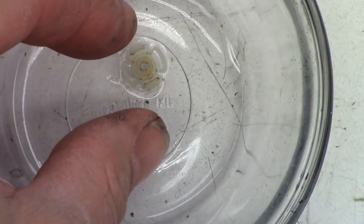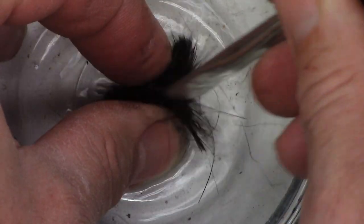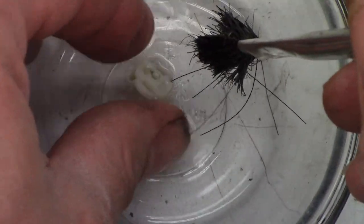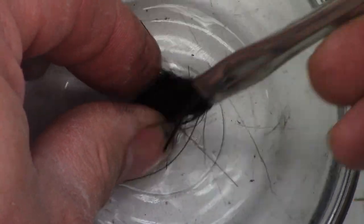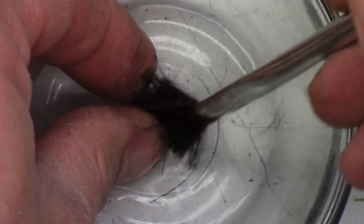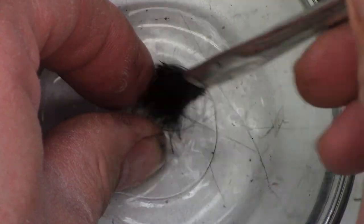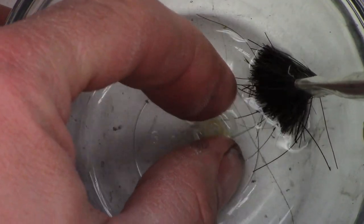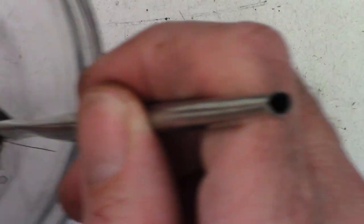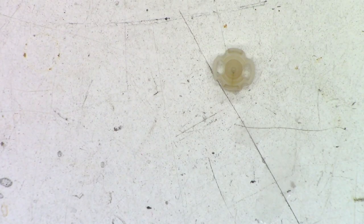Before that happens, I'm just going to drop this in some acetone and try to make sure I've cleaned out the hole, hopefully. Because the less oil there is on things, the better it grips. Oil makes it slip. And the whole point of roughing this up is so that the glue will bond in the nooks and crannies, kind of like the Thomas's English muffin. Okay. So we'll let that dry.